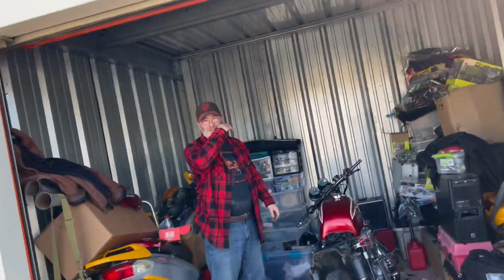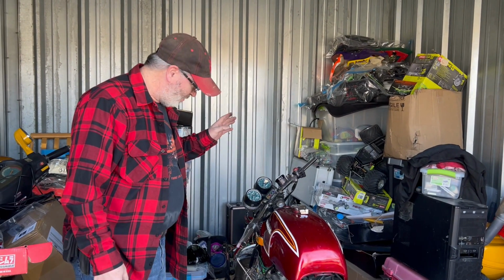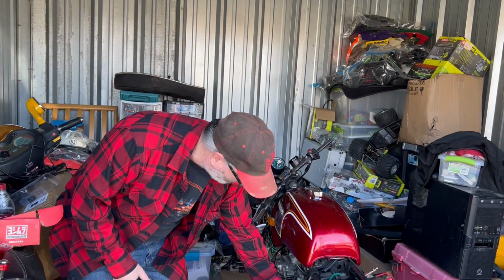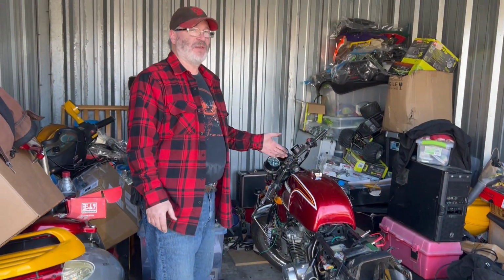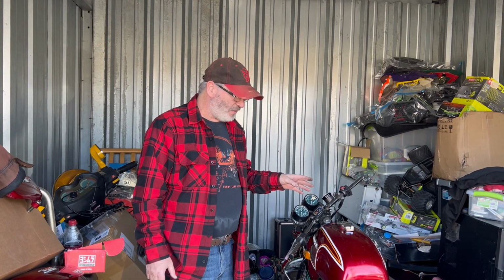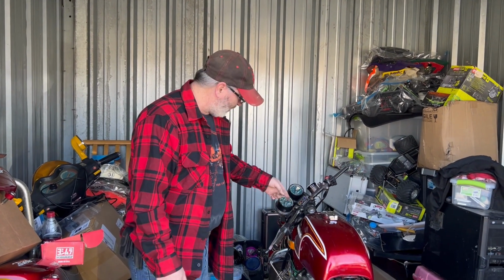All right, everybody. Remember before when we pushed it and it wouldn't start and you had to let off of it? I couldn't for the life of me figure out who the hell would do something like that. Like how this is wired up, and I'm like, man, this is a weird cable. So it turns out that this is some Dyna S electronic ignition. No more points. It's gone. With that kind of stuff, you need 12 volts to it, and then the output signals come back to the coils, right?